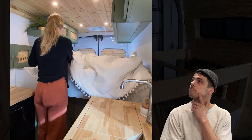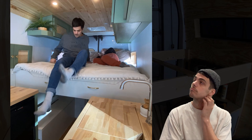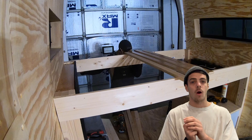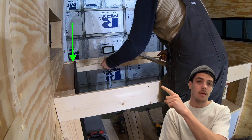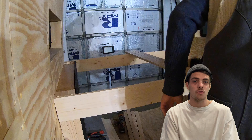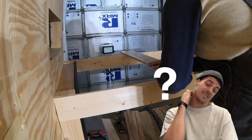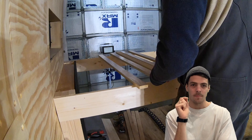After a quick look at the mechanics of the bed, let's dive in. In the garage of the van, the water setup is on the right side and the electrical system is on the left. There are four areas with two-by-fours, and I notched out those two-by-fours so the actual weight and pressure of the bed goes into the two-by-four and not the screws — a little lesson from high school physics: weight displacement.